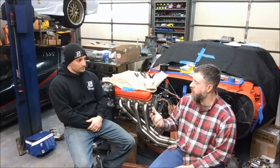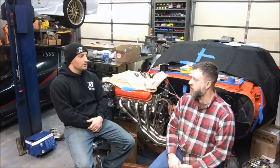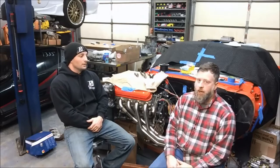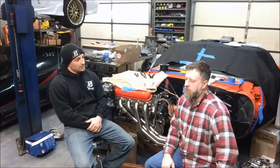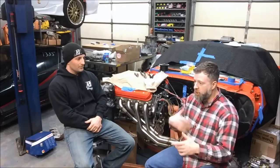From a business perspective, PSI was originally reluctant to do the E40 because it was such a rare case compared to all other LS engines. The original workaround was to run a red-and-blue PCM, mount Gen 3 valley knock sensors on the side of the block, and convert to drive-by-cable, or use the TAC module. Hopefully this video illustrates why the LS2, whether it's a 24x or 58x, can vary so much in its electronics and create headaches when figuring out the correct ECU and controller.